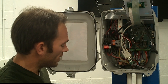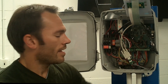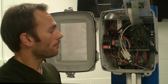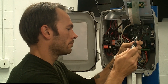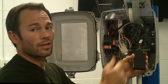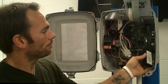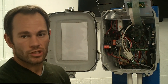Just plug it in. Once the adapter cable is plugged in, you're going to want to move the dual lock that was on the back of the existing device and put it on your new device. Just in case it doesn't have any stickiness left or if you damage it while removing it, carry a little extra with you — and honestly, it's not the end of the world to leave it dangling inside the panel. The adapter cable is directional; there's a little nub on the back of the modem that's going to line up with the clip on the cable end. Plug it in, and now this device is fully accepted by the existing panel cable. Stick it back up and adhere it to the proper part of the panel box.